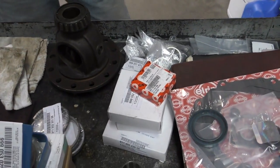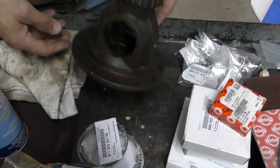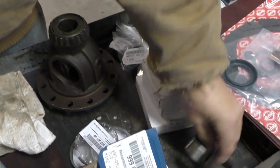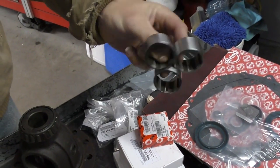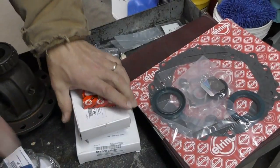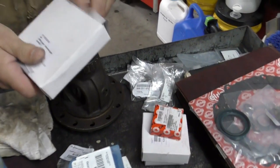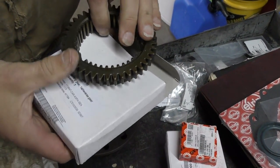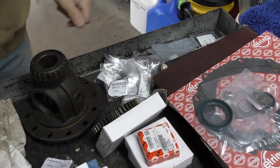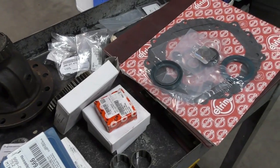We just got a little bit of update on our 902 transmission. We got a new carrier from the junkyard that we've got to disassemble and clean up because it's pretty dirty. I did get three new bearing races for the inner gears, polished and checked them, and they all look great. We have pretty much all of our bearings, synchro pieces, a new slider, and new dog teeth for first gear. We're going to start assembling the input shaft, then dive into the pinion shaft to get this entire transmission back together.